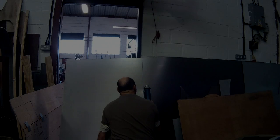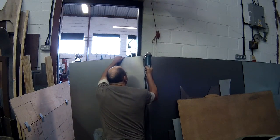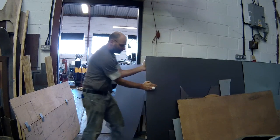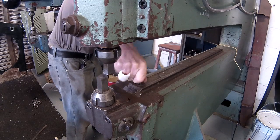Here is a short video showing how he made a rear panel for a Morgan. Once a piece of steel is cut from a sheet, I use my guillotine to cut it to size accurately. Next I cut a hole for the spare wheel.